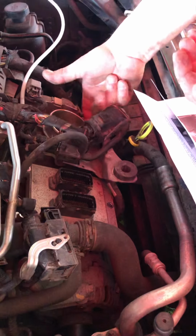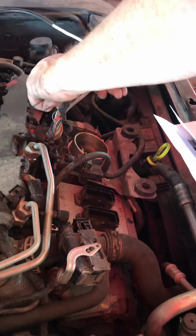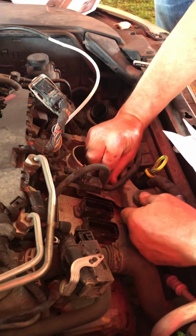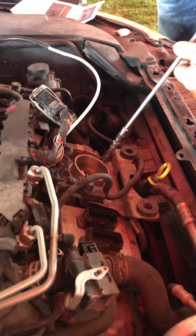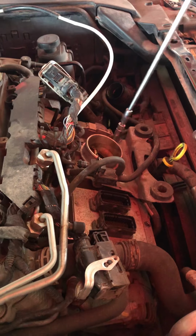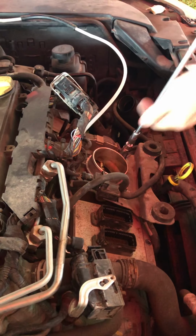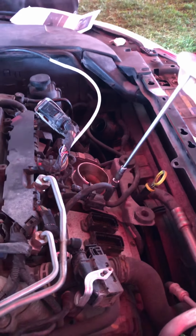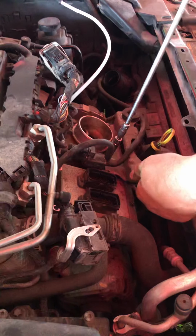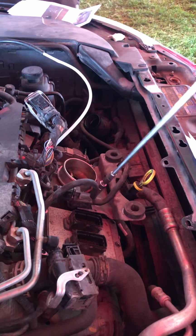And unfortunately, I forgot to bring my torque wrench today, but it's not my first rodeo. I trust your fingers. You know. Uh-oh, T8 time, huh? We're installing ECU spacers, heat insulators, courtesy of Jeff. And that is 16 foot-pounds. Trust me, I heard the click. So, not a gorilla. Not one Ugga-Dugga. It's a short Ugga-Dugga. Basically 16 foot-pounds is snug.